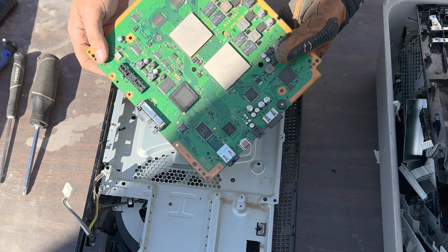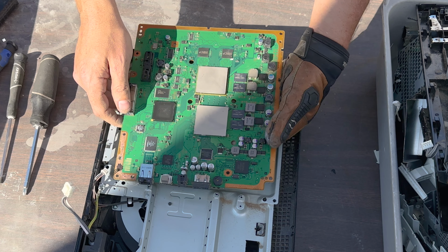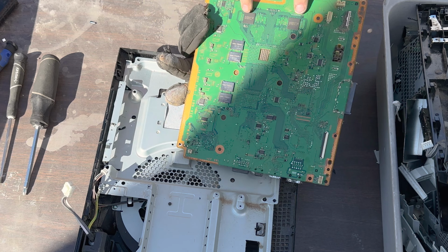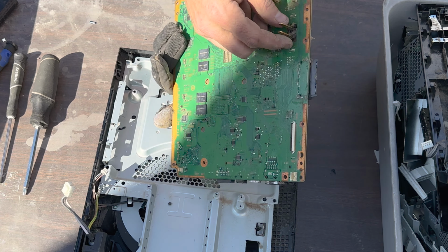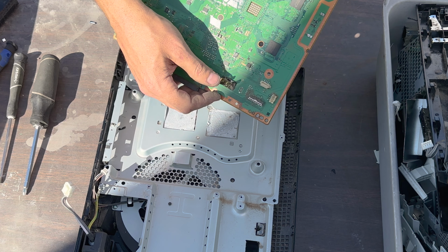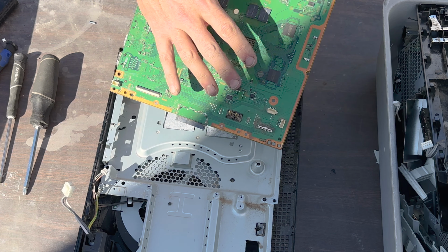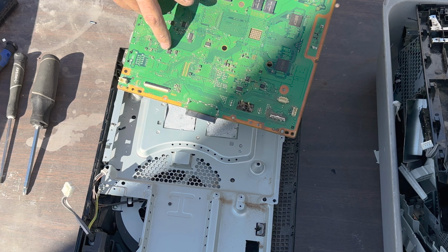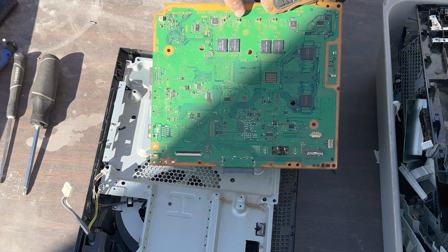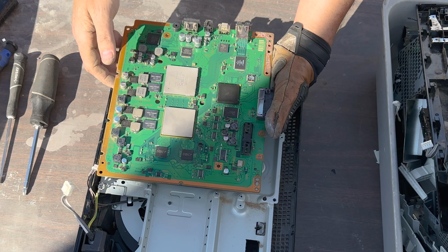Like I said at the very beginning, I don't know what is what in here, but I can at least tell you what I'm interested in. For scrap purpose, these four BGAs here, these two BGAs there, this gold-plated prong set, it doesn't look very thickly plated, but it does have a really nice gold color to it, so it's there. On this back piece, there's a few surface mount things that I'm interested in. There's a few tantalum capacitors, a whole bunch of really small MLCCs. But in general, I'll scrape them off. They're interesting. This side's got the best value to me though.